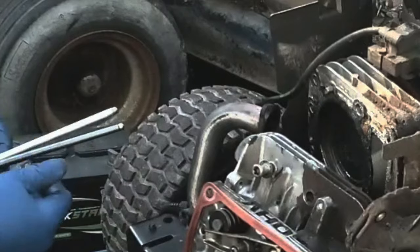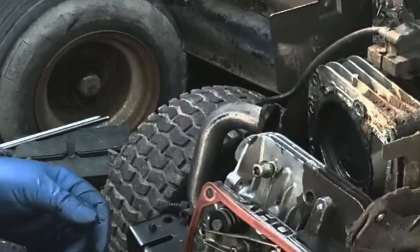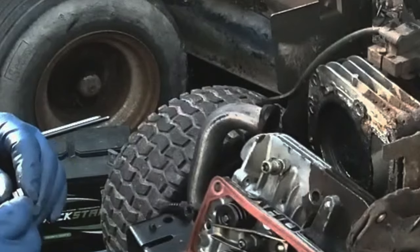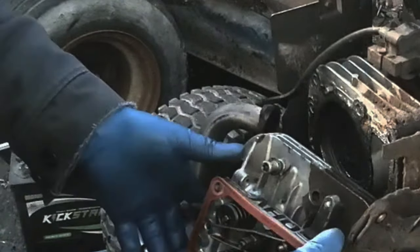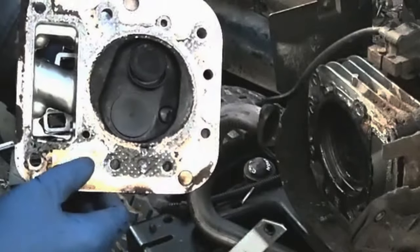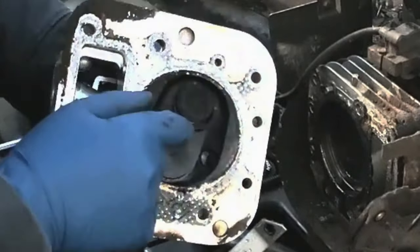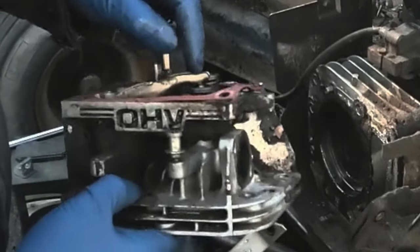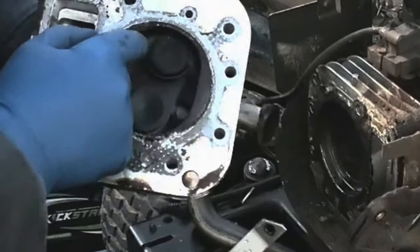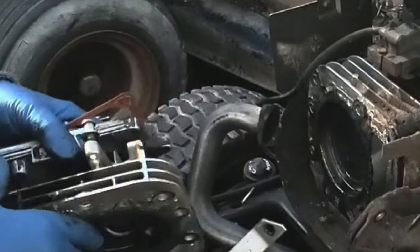I'm pretty sure this one's aluminum because it's going to the exhaust valve to help transfer a little bit of heat. They are both the same size, except one's steel and one feels like it's aluminum. We want to take these little caps off the valves so they don't get lost — they're both the same, so it doesn't matter which one they go back on. Now we'll look at the head — and there's our problem. The valve seat popped out. That is actually fixable: take the valve out, compress that spring, take the keepers out, take the valve out, put the seat back in, take a small center punch and peen around there, put little indentations in to hold that seat in. That's what put this out of commission.